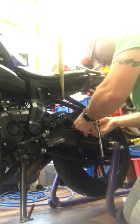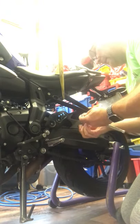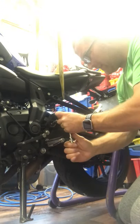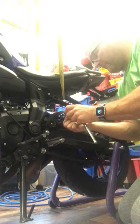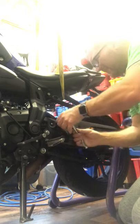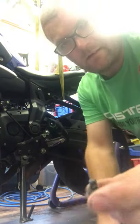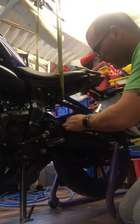This one will come off nice and easy. There's a little spacer on it. What I have to do is move this out of the way with a 4mm. Just slacken that off. Set the foot guard out of the way — it makes it a bit easier to access that bolt. Little spacers on them bolt slots. Try not to lose that.